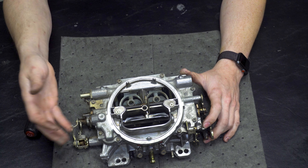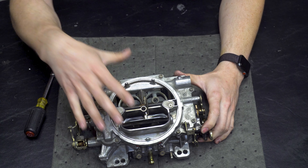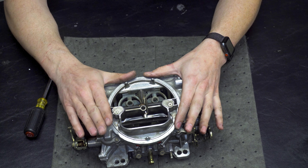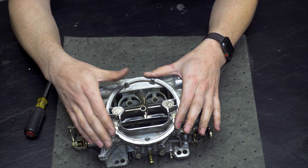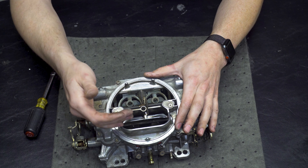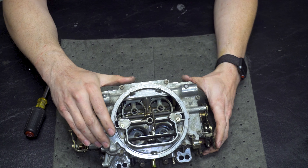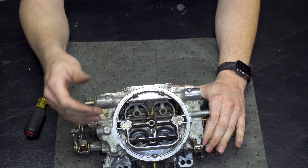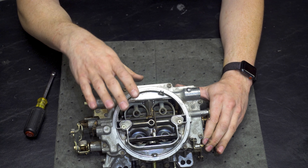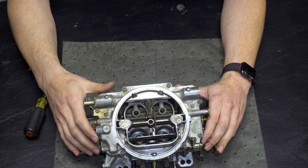Then we revert back over to our standard mass airflow, volumetric efficiency, or dynamic airflow to do all of our metering. One thing to keep in mind on a carburetor versus EFI: a carburetor is the equivalent of mass airflow, not speed density so much. The way speed density works is it uses a load-based calculation off of RPM and manifold pressure to calculate the amount of air. Whereas a carburetor is literally using the airflow itself to calculate the amount of air, which in turn calculates the amount of fuel — much like a mass airflow sensor does. The more airflow that we're registering through the sensor or the device, the more fuel we get in turn. Both a mass airflow sensor and a carburetor are air metering devices that provide fuel based on the amount of air metered.